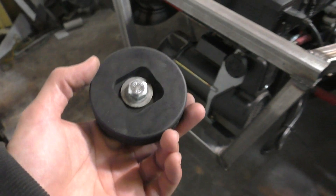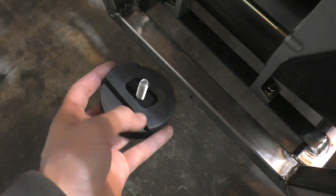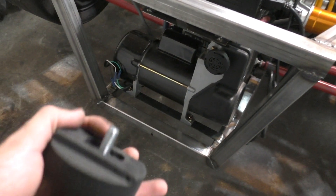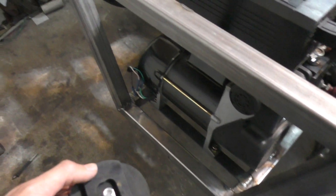For these mounting points, the places where it has to go on the chassis were already figured when I was making the chassis - I made all the bolting points back then. There's also one at the back on the crumple zone which is going to act as a jacking point. What I've done is machined a hockey puck into a special shape so it will bolt up there, and where I've machined it away is where the carbon fiber of the diffuser is going to go - making sure that even when the bolt is fully tight it doesn't put any pressure on the carbon fiber. This is really important because if you directly bolt carbon fiber to steel and torque it properly, the torque of the bolt will crush the core in your carbon fiber, crack the part, and make it completely useless.